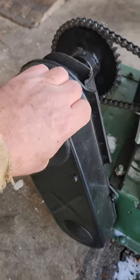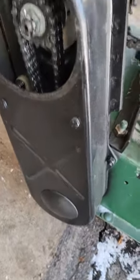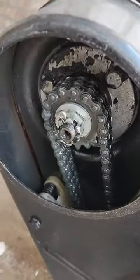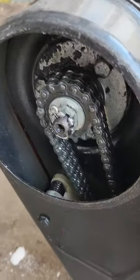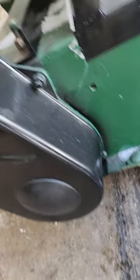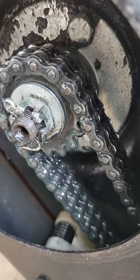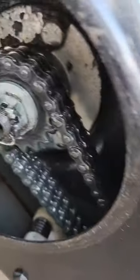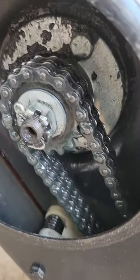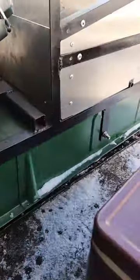This originally came with the snowmobile. It's got a double-strand chain in there — it's a type of diamond chain. You just fill this up with a little bit of oil to keep it lubricated. That looks really nice and new. I don't know if he replaced it — he might have, he probably did. It looks pretty new. It just goes down the tunnel to drive the track.